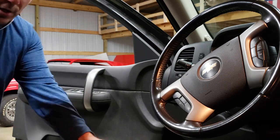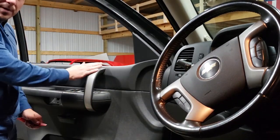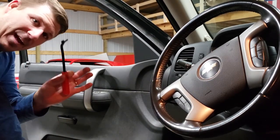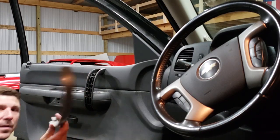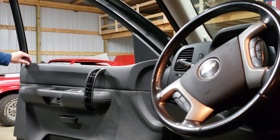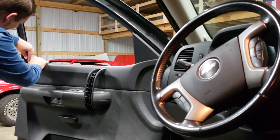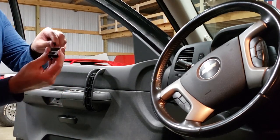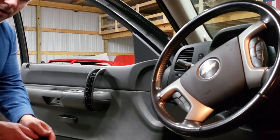No damage. Next, use the flathead screwdriver or a panel popping device to get underneath this plastic piece — there's a little tab on the bottom. You also need to take off your door lock cover: there's a little tab you just press and it pops out, then you can pull it out — it just locks onto the actual rod that locks it.